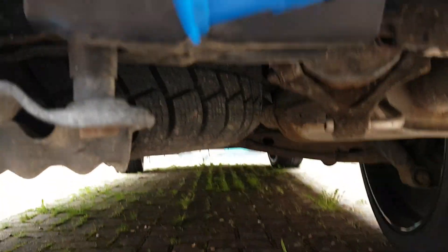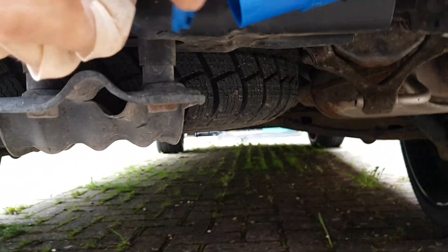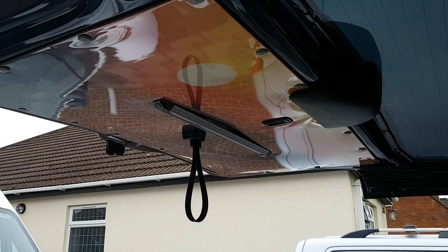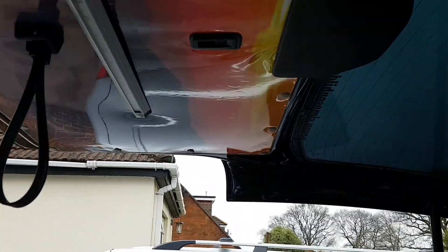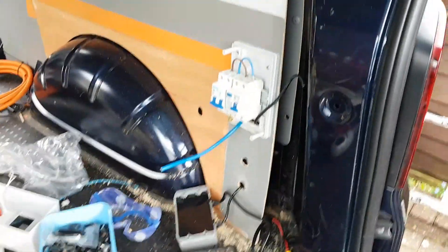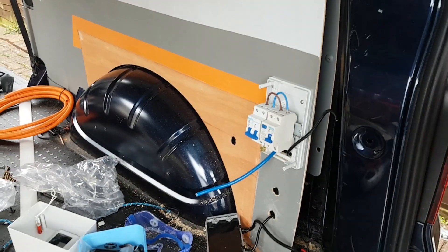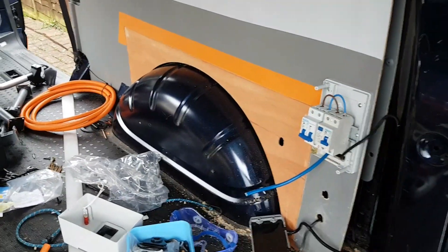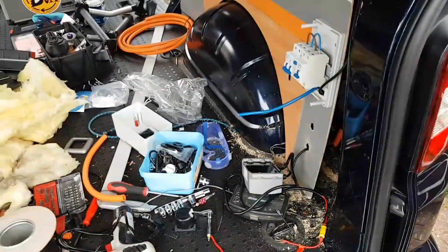The shore supply is now on. It's a little bit clunky but it works. The LED light in the tailgate is in. We're just wiring up the RCD — earth leakage protector — and the AC breaker to protect the sockets. AC breaker for the AC sockets. We're just wiring that up now. Here's our charger. It's coming along nicely.